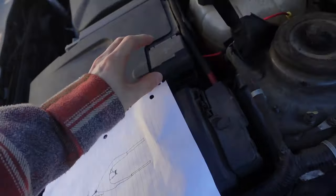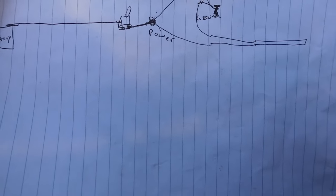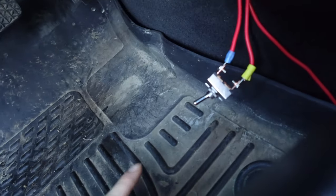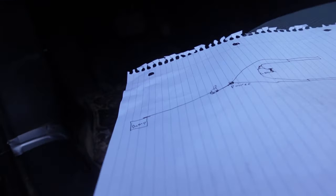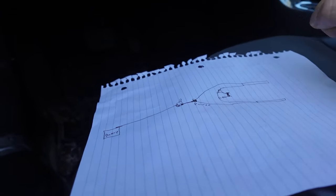You see the battery connected to the wire — the terminal. Right here. And this is actually for protection. It goes through the car, through the hole there, comes out of this hole, wire around — it's a switch, just like we have here — just following this map. We're at the switch, and the wires connect here from the battery. This is where the two positives are, and then the ground goes right here. The wires go under the mat, taped. Here we have the switch. We have the light — just like we planned. The positives, on/off switch, they get power, and the ground — just like we planned out.